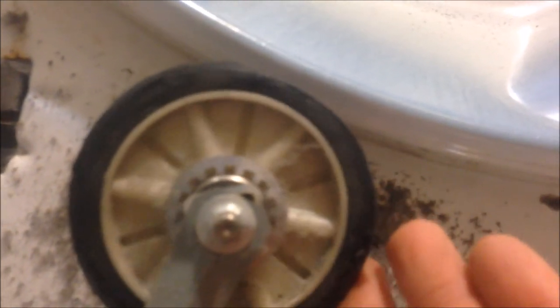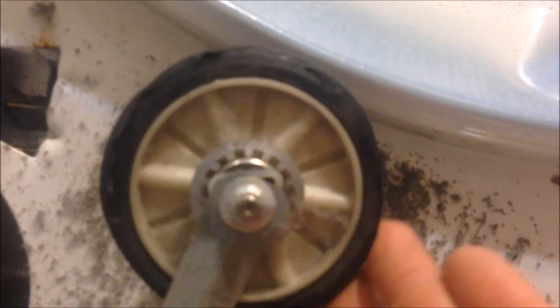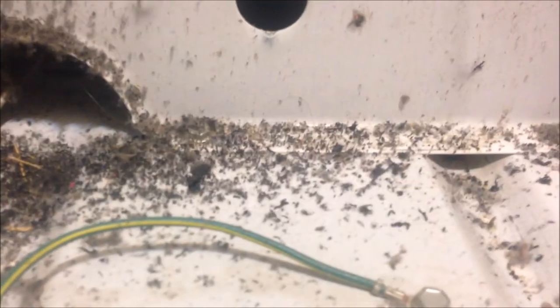Now with the drum removed, you can see what happened here. Here's one of the two rollers — you can imagine how bad that would make the drum sound. You heard it in the beginning of the video. So these assemblies get replaced, this roller gets replaced. This roller gets replaced too. You can see where it's been throwing rubber off the roller everywhere — there's a big pile of rubber there.